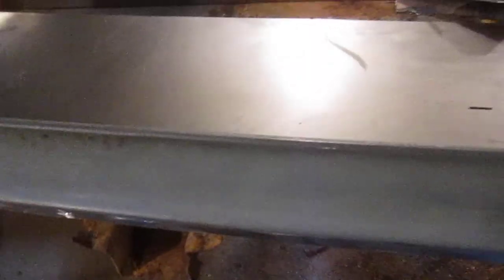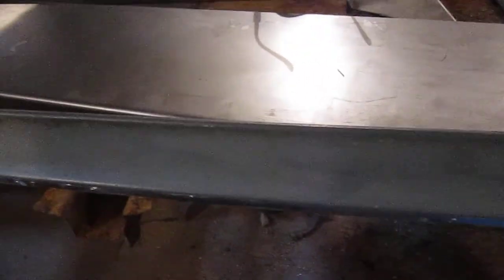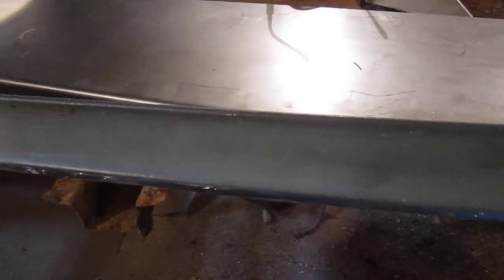This is a little tip if you guys are on a budget like me and you don't feel like buying the whole rocker section from the vendors. This cost me, I think it was like $23 a side — I got both sides. And then this pan here is actually the inner floor with a quarter-inch lip that welds to the inside of here. I got nine inches because the floor pan is pretty rough.